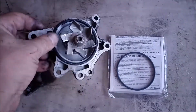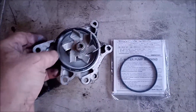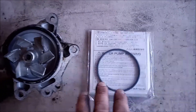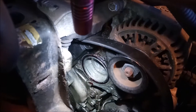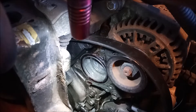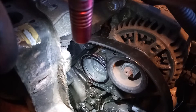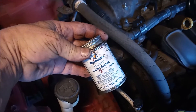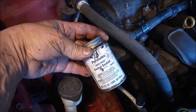This is the old pump with the o-ring stuck to the flange of the pump — loosely stuck here. And this is the new o-ring; you must place this in the groove on the engine side first before you attach the pump back to the block. Here I've seated the o-ring securely into the groove and I've used some gasket adhesive to make sure it stays there. This is the gasket adhesive I use — it's a Permatex product. It seems to work pretty well for all kinds of rubber gaskets.